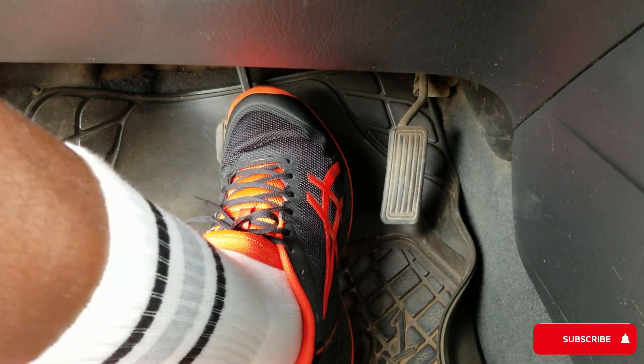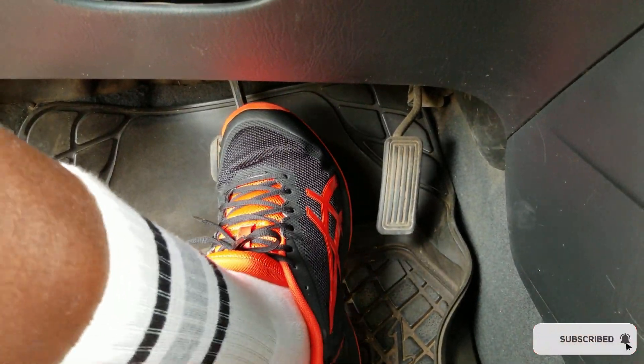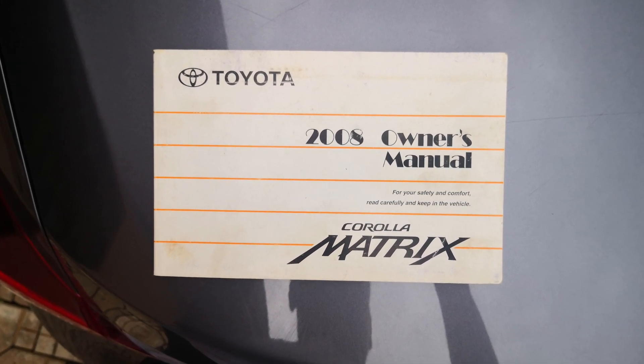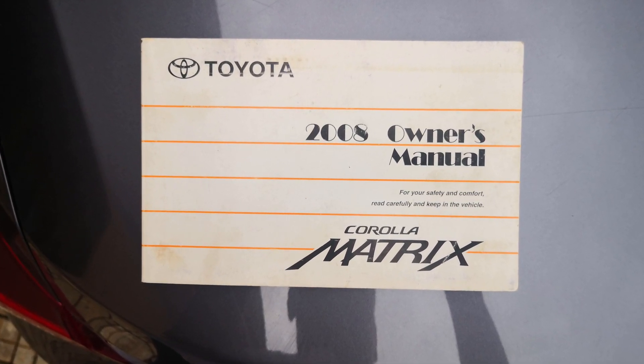This kind of brake failure may be intermittent since braking tends to recover when the system cools down. Most manufacturers recommend changing your brake fluid every three years. Be sure to check out what's recommended in your owner's manual.